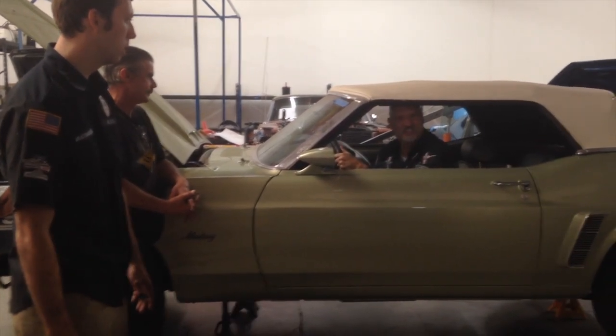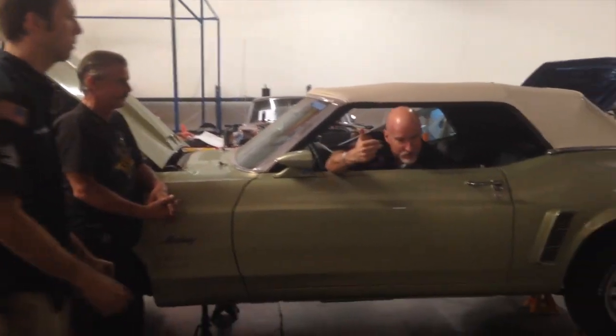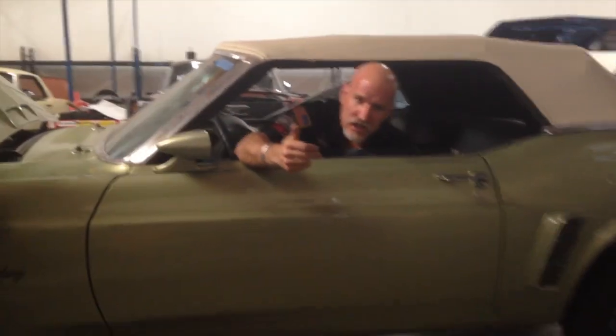Tilt the wheel down. Hand on key. No vibration, Bob! Woo! It was the flex plate. It was not balanced properly and it was giving us a vibration around 4,000 RPM. She's rigid because of your rigid mounts — those neoprene mounts you put on. She's tight, but she's not out of balance.